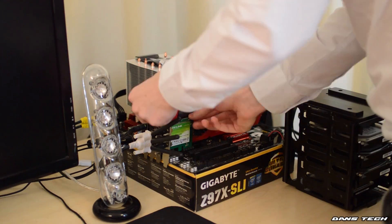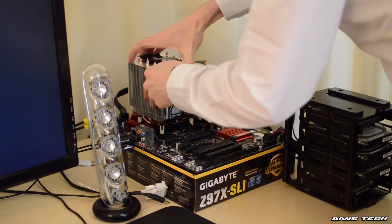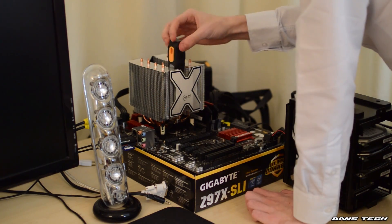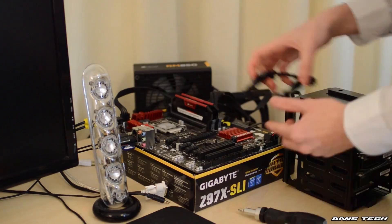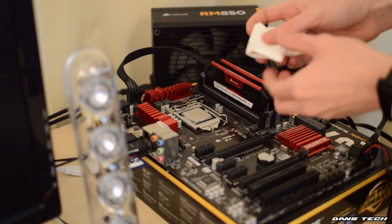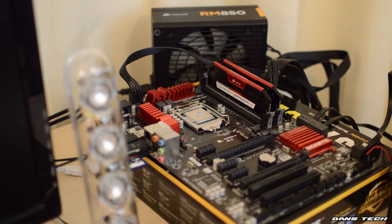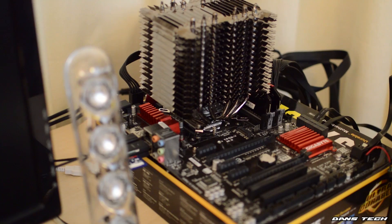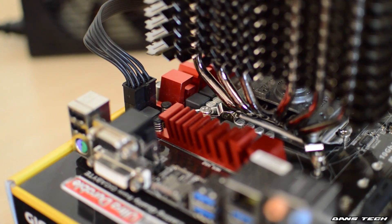On to the installation — the overall installation was okay, nothing too difficult, but by far not the easiest cooler to install. The only real problem I had is that the cooler had to be installed in an orientation I didn't initially prepare for, as the Corsair Vengeance RAM I have installed is quite tall and got in the way. Thankfully you can install coolers on LGA 1150 in any orientation since the socket holes are in a square pattern, unlike older sockets like AM3+ from AMD. The second problem was screwing down the cooler — the screwdriver had to be at such an angle that I really think this needs to be redesigned to allow easier installation.